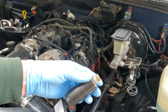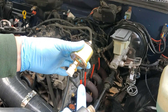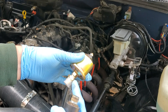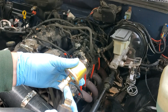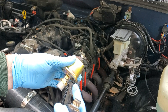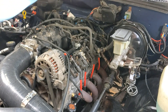So now what we're going to do is replace this with our oil pressure sender. We've already got our pressure sender installed to the LS kit. When we install it we're going to use a wrench and turn on this part — we're going to put our sealant on, put our gasket on, drop it in, and tighten it by the bushing. Not by the sender itself, because we don't want to damage this connection here.